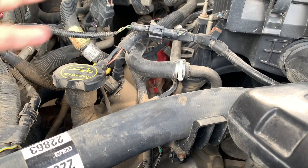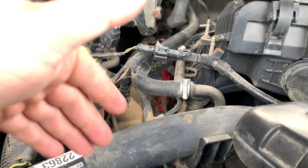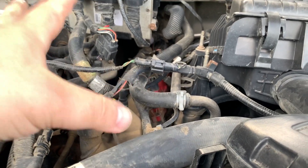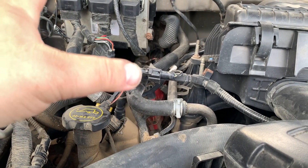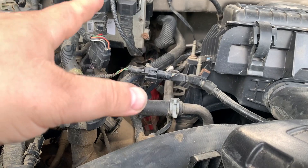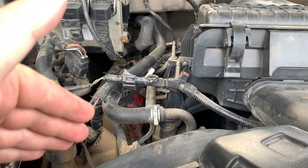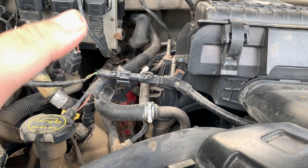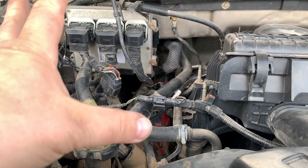Just did a few tests to verify the harness is good and to make sure the sensor is good. These diagnostic tests are good so you don't throw parts at the problem. When you get all those codes, it could be mechanical in the variable timing, it could be the sensor, or it could be in the harness.